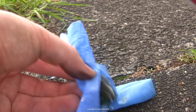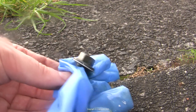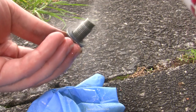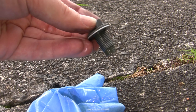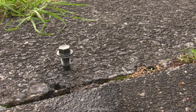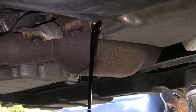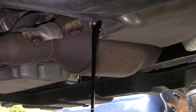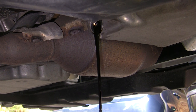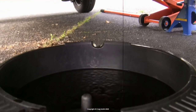This plug is in reusable shape but the hex head is a touch mangled — that's from the over-tightening and letting sockets get misaligned in the past. I might replace it next time, but I don't like replacing them often even though they're cheap, because the steel thread is very hard whereas the aluminium of the sump is soft. Every time you put a new bolt in you cut slightly different threads due to bolt-to-bolt variance, and eventually you'll weaken those female alloy threads. When you strip the sump plug itself you've really got a problem that's not easy to fix.